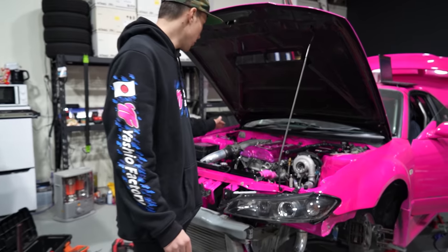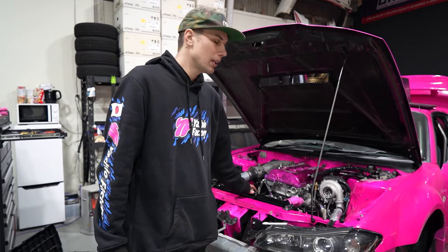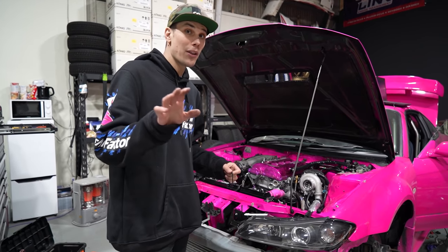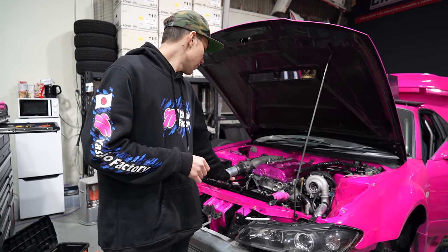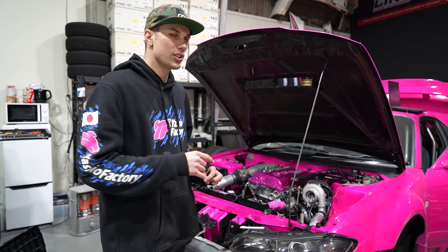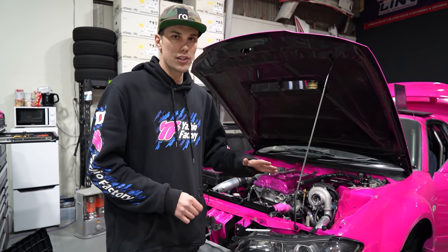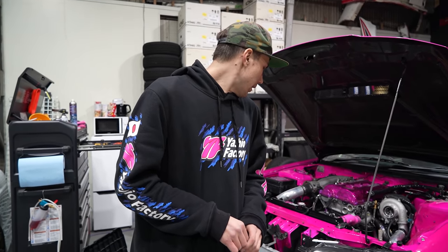But when you do thermos correctly and you make sure you have an alternator that can power them, you can tell that as they turned on, the alternator took on the load. So there's a change in idle there, which by the way, you can set up on the Link so that it reacts differently. But when the fans turn on, the alternator can handle the load and there's no stress to anything else on the car. Checking the voltage, you could see there was no blip or anything in voltage. It was stable. So that's why you upgrade everything, alternator, wiring, make sure everything is rated for the amperage and the draw of the current. But anyways, I'm excited about that.